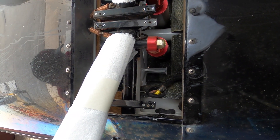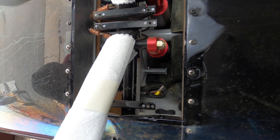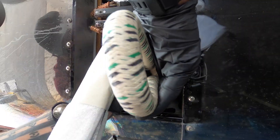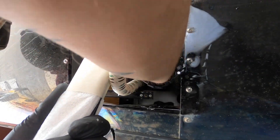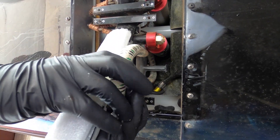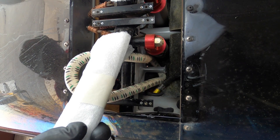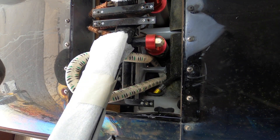You want to make sure that you've got your 1280s on the outside and your 1380s on the inside, so your 1380s will go on first — those are your stronger ones. You have a hook back here opposite the one that's in front; it looks just the same. You want to pinch this as best you can. There's a little lip that you have to bump it over, and once that pops into place you've got a good hold. Then you'll pull it over the top of your landing gear strut. Always cover your landing gear struts with some kind of foam or anything that will protect it, because your bungee tool will take the paint off.